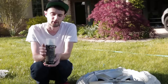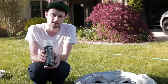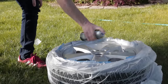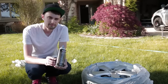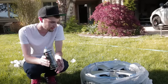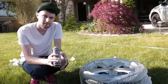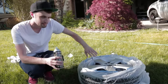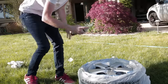After we've given this final coat a few minutes to dry, we can go ahead and start with the clear. We're going to do two coats of clear coat — the first coat is just going to be a light dusting just like we did with the paint, and then the second coat will build it up a little heavier. The last coat with the clear coat is probably the most important out of all the painting we've done so far, because this is going to be the final coat that you see. Layer it on nice and heavy and get the whole wheel wet all at once so it dries even, but be careful not to get it so wet that it drips.